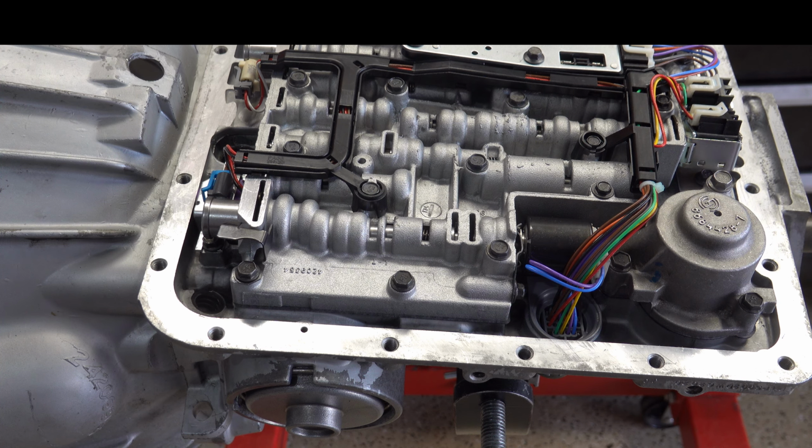So I prefer to manage to a range of between 40 thousandths and 85, or at most 90 thousandths. Let's just call it 90 thousandths on the high end. I think that gives you a band clearance that is a perfect balance between not inducing any drag, right, where the band around the drum is not too tight, and also not so loose. It basically precludes any possibility that you might have a 3-2 flare on wide open throttle downshifts.